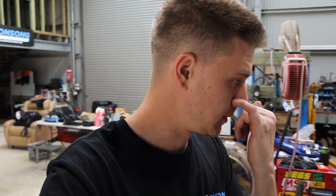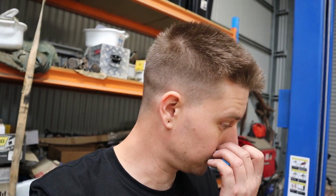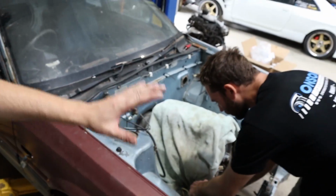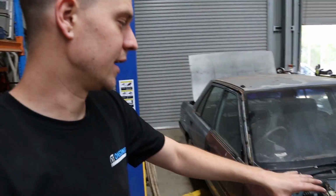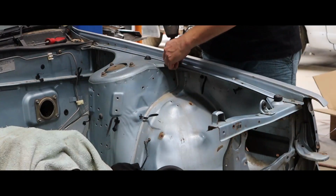But you would have seen that me and Rex managed to buy an R31 clutch pedal off Liam. Liam was kind enough to sell us one of his because he had three of them. So I've got a new clutch pedal to go in this car that's actually right for this car and it's going to work. I've got to cut the brake pedal, the old cut the brake pedal trick with R31s. Most people who've done a manual conversion on an R31 will know that one. And also got to look at maybe dummying up our brake master cylinder and stuff. So a few things we can go on with, drilling, doing stuff with the firewall. Because once this is all cut and we're happy with it, we want to get in and paint this bay pretty quick so that we can continue on with our wiring and everything else we've got to do in the engine bay.